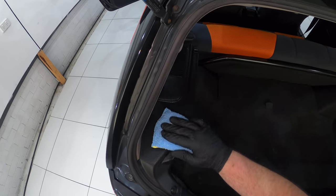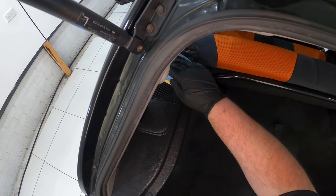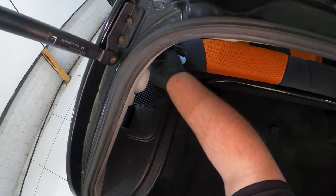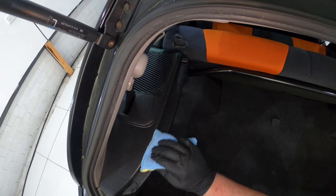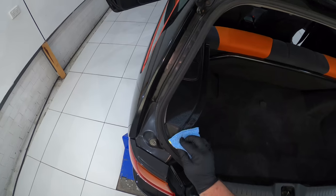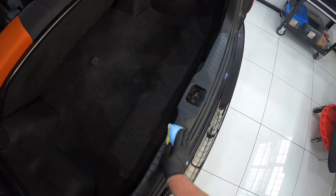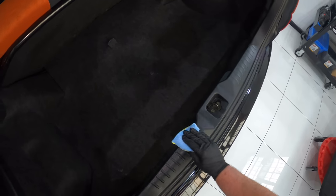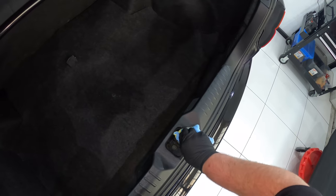I'm just using the micro suede side of my Tyres applicator to apply it, putting a little more on to start with to prime the applicator, and then basically just massaging it into every surface, minus the fabrics and glass. For the most part, Guardian will self-level on the surface as long as you work it in reasonably well. But what I usually do is coat the whole interior and then come back with a microfiber cloth to level down any high spots here or there or any excess coating that needs a wipe down.